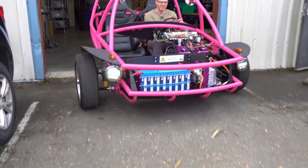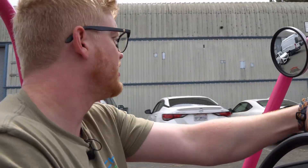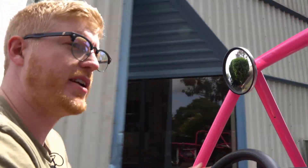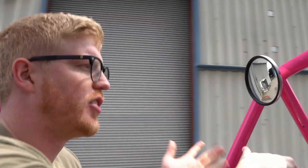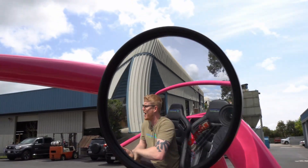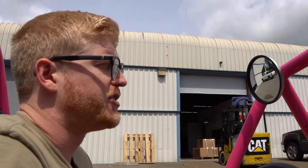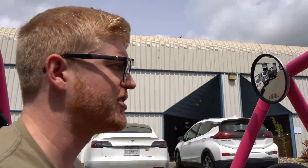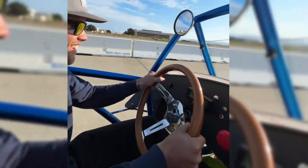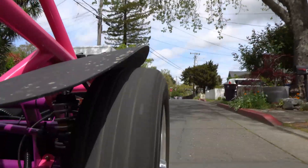The Switch Lab is a 7.4 kilowatt-hour battery using lithium iron phosphate cells. It's got about 50 miles of range depending on how you drive — if you're aggressive or if you have regen on high. It's got a max speed of about 85 miles per hour, which is real quick, but we want students to build something that's fun and exciting. Teachers really like to take it to drag strips. It comes with Volkswagen suspension — the trailing arms on the right and left.